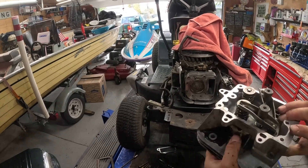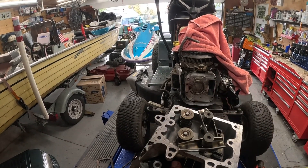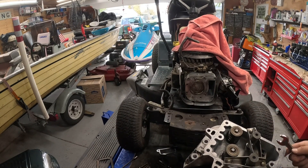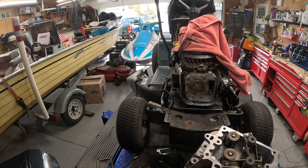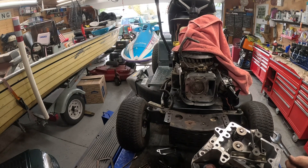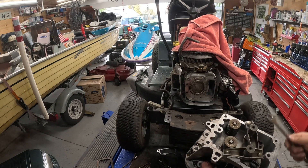When we started this video and took the head off — the reason I took it off was there was so much oil built up around there that I thought I saw something on my bore scope that I didn't see. But I knew this thing had an oil leak anyway, and these are common for blowing head gaskets. This one was seeping, so it was going to blow.